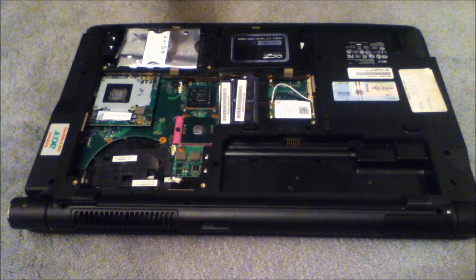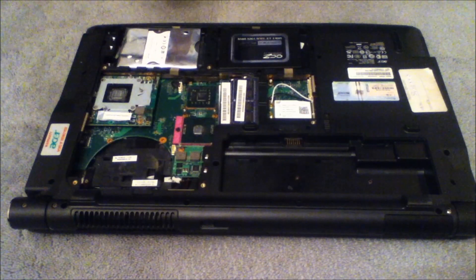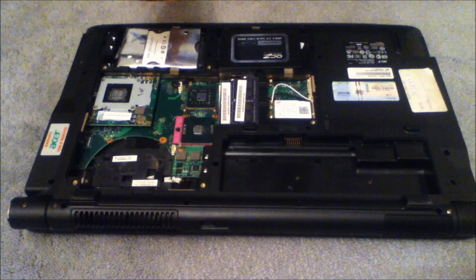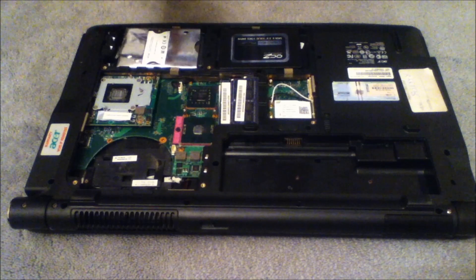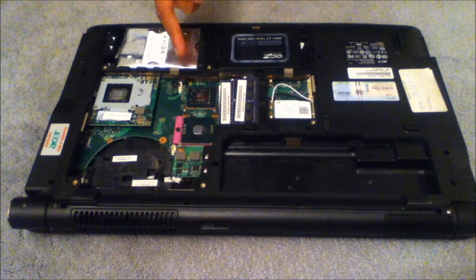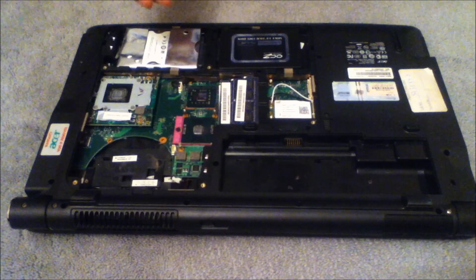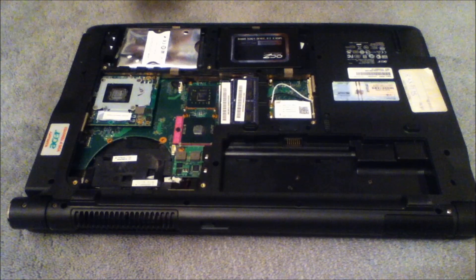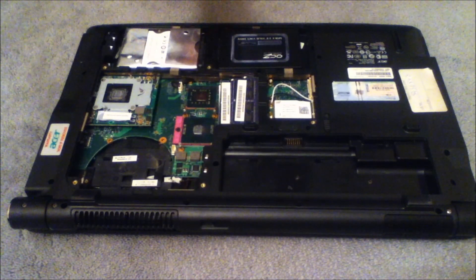Just take it and rub off as much as you can. By the way, it turns out I've got a third chip of some sort which I'm not sure what it actually is. I've got my CPU there, GPU there — that's Intel and that's Nvidia. But this third one I'm not sure about, and it didn't come with any thermal compound on it, which is why it's really shiny. So I'm not going to apply any thermal compound to it. I've seen other people who've got three chips and I'm not actually sure what this third one is.